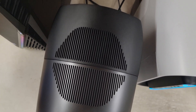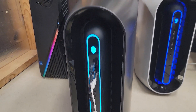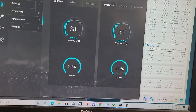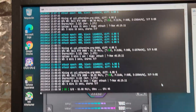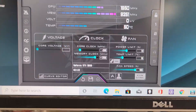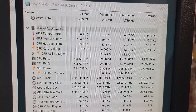You see we're still at 42 degrees. This thing just wails with noise — it's really loud. We're going to go ahead and swap out one of the fans at a minimum to make that quieter. With 100% fan, we're at about 38 degrees in the case. But unfortunately those junction temps are still out of control — 108, 110 degrees — and we're only getting around 82 megahash per second.